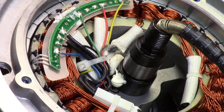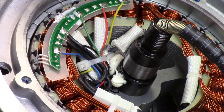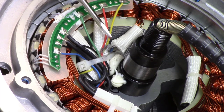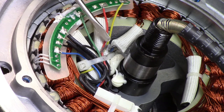This is beautiful. As you're troubleshooting something like this, this is exactly what you want to find, because it's a definitive issue, meaning that we know we found a fault. There's no question. I'm going to leave this zoomed. It's right there. And you can see where that wheel, or the hub, rotates around, and the yellow wire has been rubbed off right there, and the red wire has been rubbed off right there. When I check them in this mode, they aren't shorted together, because the metal's gone from the hub. When you put the hub back together and it spins a little bit, then these two surfaces short together. Bam, it stops running.